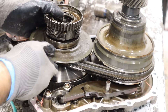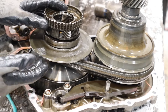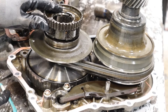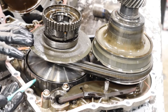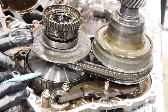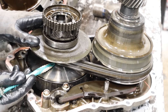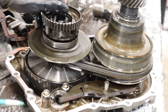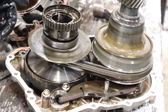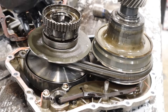It's kind of different from your alternator belt where you're always pulling it. You always have to have tension on this belt — otherwise it's going to slip. Remember, this whole thing is encased in fluid and these are metal-to-metal surfaces; it's not like a rubber belt where you have grip. So fluid quality and fluid pressure are very important in a continuously variable transmission. Let's say we're in the first gear ratio — we've got the smallest cog on the input and the largest diameter on the output. That's going to give you a torque multiplication, but this gear is not going to move that fast. That's great for a reverse gear or a forward first gear.